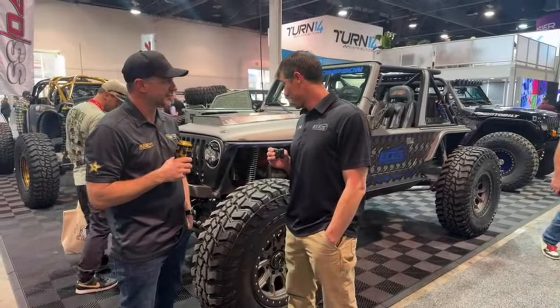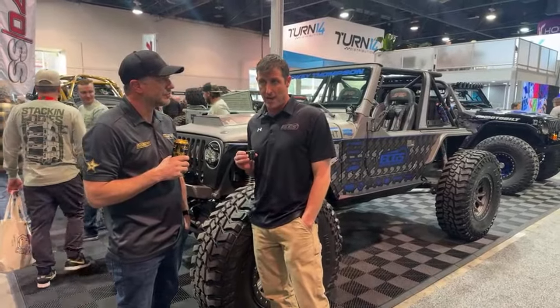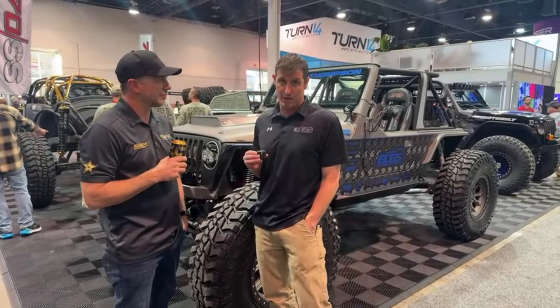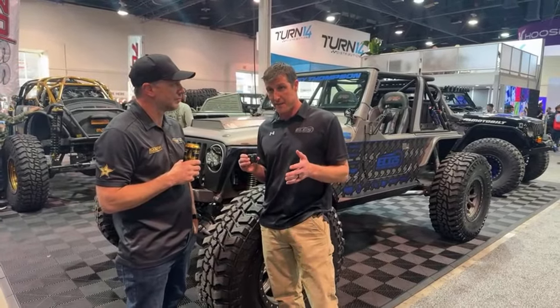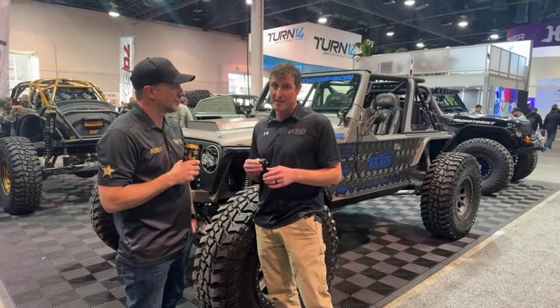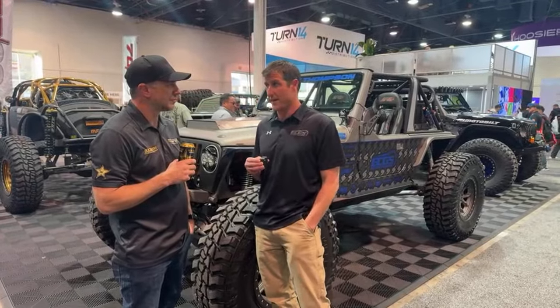And he chose to do a steering 14 bolt in the front. A lot of guys opt for the high pinion 60. We have our own high pinion 60, high clearance casting. And then the rear is 40 spline. It's a forged spindle, very heavy wall. The bearing separation is very wide, and all that translates into strength. Our spindle yields at 80,000 pounds, where a normal 1-ton spindle is a 20,000 pound yield.